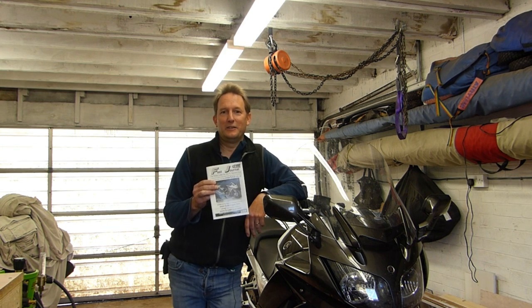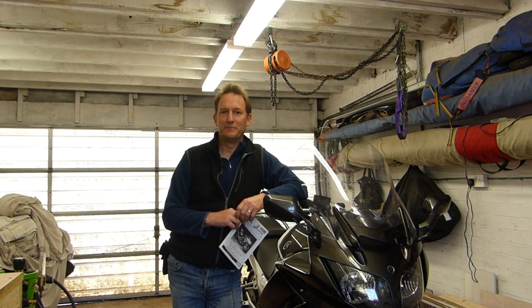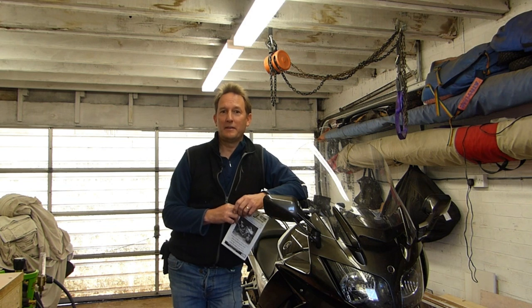No copy of the UK owners club magazine is complete without dire warnings of the consequences. The big trouble is that if you start to have the linkages seize up, it can cause fatigue and ultimate failure in the dog bones, causing the rear suspension to collapse. So it is something that we really should attend to. So without further ado, let's crack on.